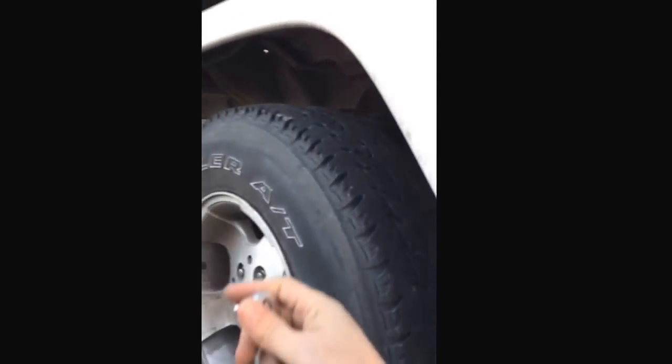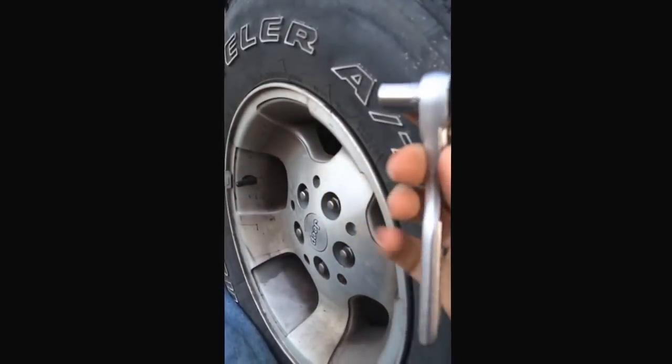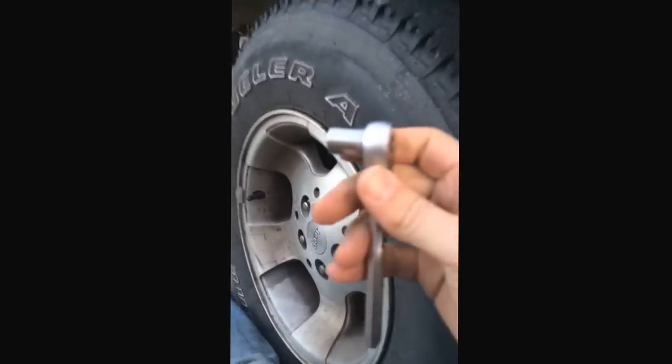Okay, I'm here on the driver's side. I've got a 7/16 inch socket and a small ratchet, so it's pretty tight in there. I've already got it loosened up. There's a pretty good shot of where it's at, right up here. You've got to take this bolt out. There's a bolt down below it. Don't take that out, that's holding something together. This one's holding in your crankshaft position sensor, and you want to remove that. I think I've got that loosened up enough so I can finish it with my fingers.